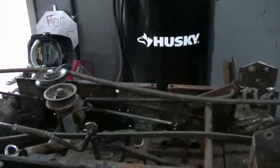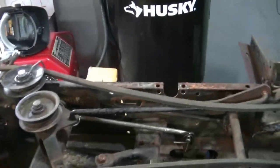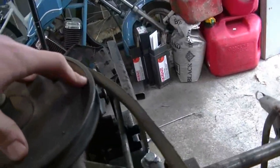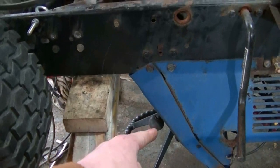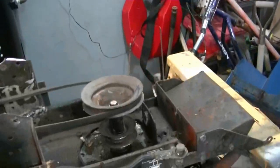Here's the dealio boys. I got everything hooked up — I got the clutch hooked up, I got the brake hooked up, got the shifter hooked up. My brake runs right along here, through there, and onto my brake system. And then the clutch is right here, which connects to my clutch pedal. So I'll have a hand brake, a hand shifter, and then a clutch on my foot. So now I'm working on the steering.